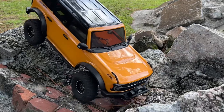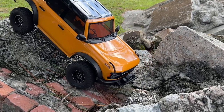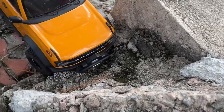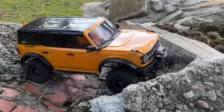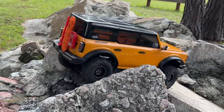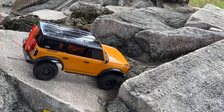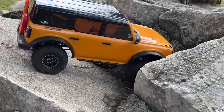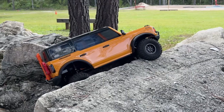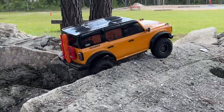Let's bring it right up through here. One of the things about brush motors and killing them is when you stall them — don't keep driving when the thing is stalled. Brush motors aren't as durable as brushless. Brushless motors are typically more powerful and more durable. There are exceptions to the rules, but for the most part, brushless systems are way more durable.